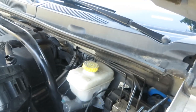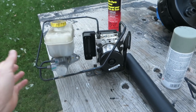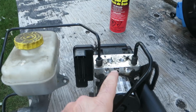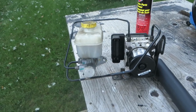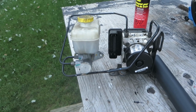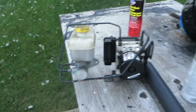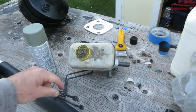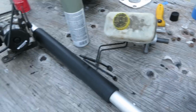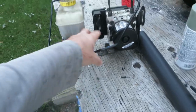I was able to get the master cylinder and ABS unit out of the vehicle, left them attached for the time being. I'm not sure which master I'm going to use yet - I'll probably just leave the existing one on. One of the other symptoms I didn't mention earlier was that the brakes were getting stuck on. I think the vacuum leak was causing an imbalance and holding the brakes on a little bit - not enough to stop the vehicle, but it would heat up the brakes. When you take the master, take the lines with it so you can just bend them back in for bleeding.